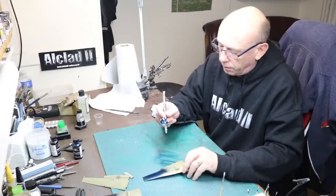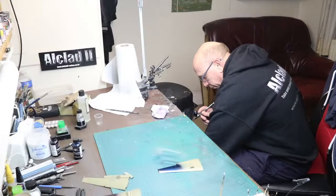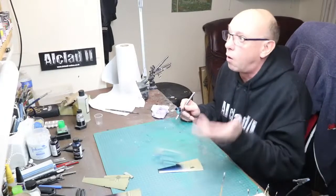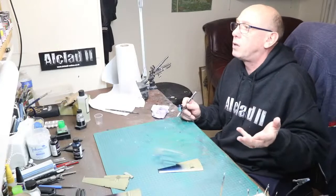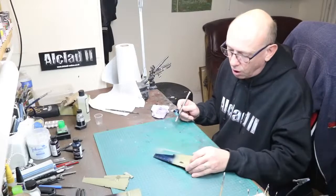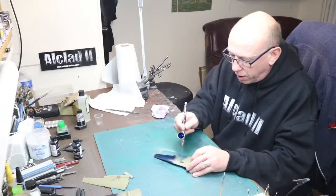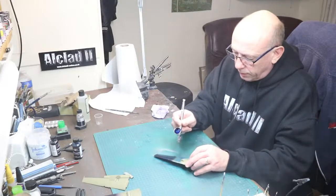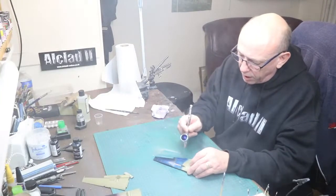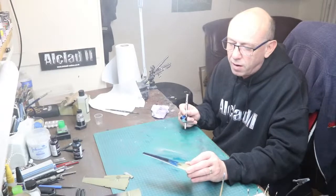Okay, right. Someone who's been spraying acrylics all the time doesn't know how to spray enamels. Everything we spray at 10 to 12 psi, except for the gloss black base, which you turn up to 15, maybe 18. Okay, so you come in, somebody's blasting it on like you would enamel, because that's crap. Oh look, I'm doing a quick coat. Oh, look at this brilliant colour, but it's running, it's everywhere, it's hideous, and that will take forever to dry.